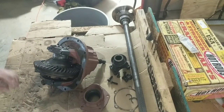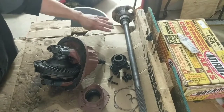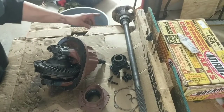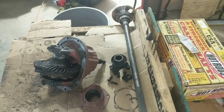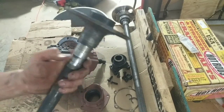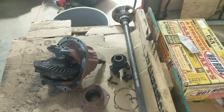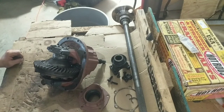You can see I'm replacing the axle — this is out of a 65 Mustang. See where the bearing tore up here? Had to get a new axle shaft. This is actually a cut-to-length one, but you don't need to do that — this is just full length for the right side, and I think the right side is longer.